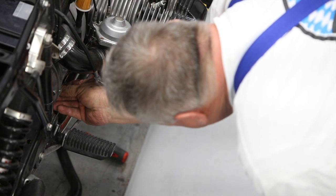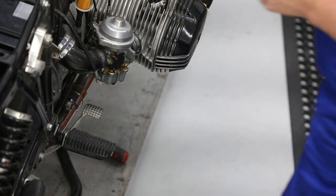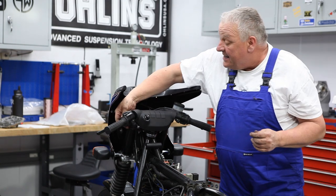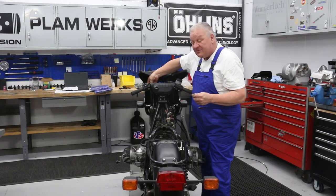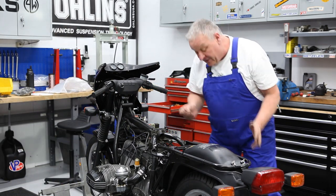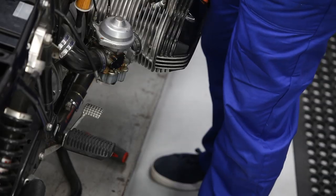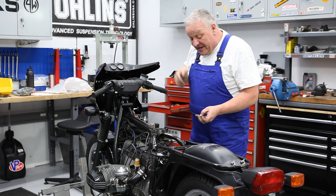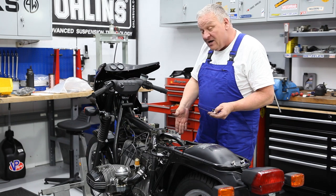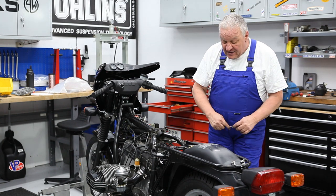If you hold the wire down at the gearbox housing on one end, and at the other end at the bottom of the half moon of the clutch lever, you'll have the proper base adjustment. In order to get that adjustment of 202 millimeters, I made adjustment on the cable up at the lever so that I've got 202 millimeters from the back side of the gearbox where the clutch cable goes through to the lower part of the half moon on the clutch lever.